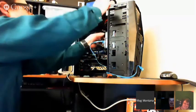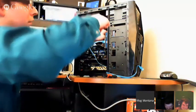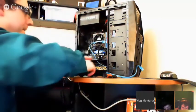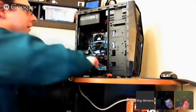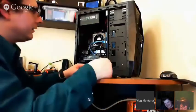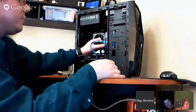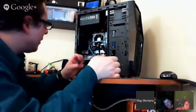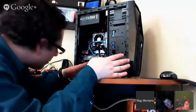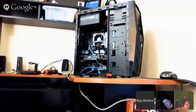You have to jerk it a little bit, you know, just to get it loose. Okay, one more hard drive. Were you actually shaking when you picked it up? But for initial boot up, what I'm going to do for safety reasons, I'm going to disconnect power from any storage device like hard drives. Just in case I did something goofy, but I think I'm okay, so I am ready to clean up the desk here and do something here.